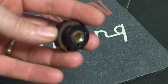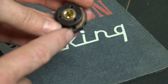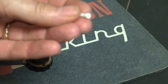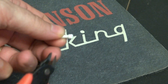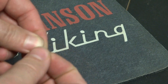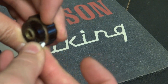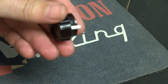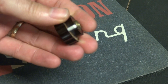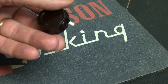To demonstrate, I've got a knob here. This is off a Challenger. Kind of hard to see, but it's missing the little pointer pin right there. So we're going to take our little Deutsch plug, good pair of wire cutters, snip that off, and get the burrs off of it. Take your knob — that pointer goes in there and looks just like the original. It's nice and tight. You can take a little drop of adhesive before you put it in there, and that thing will be there for another 50 years.